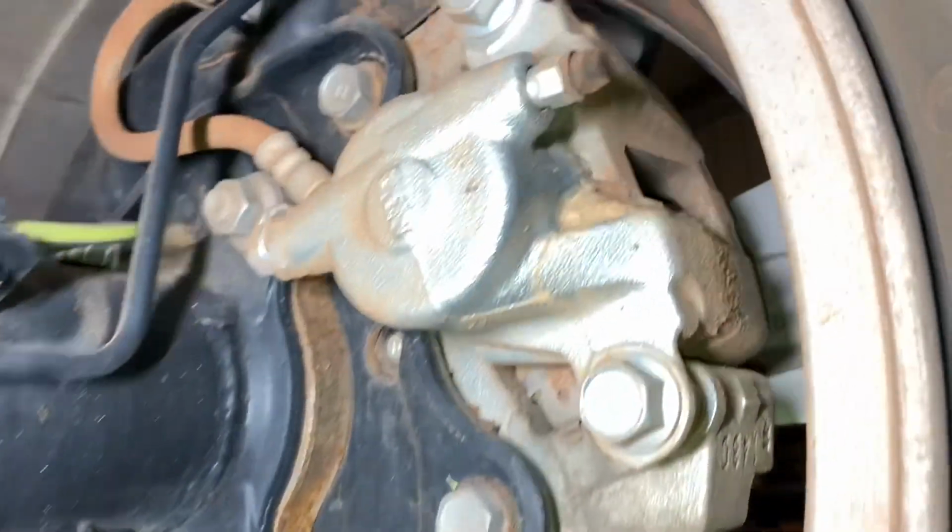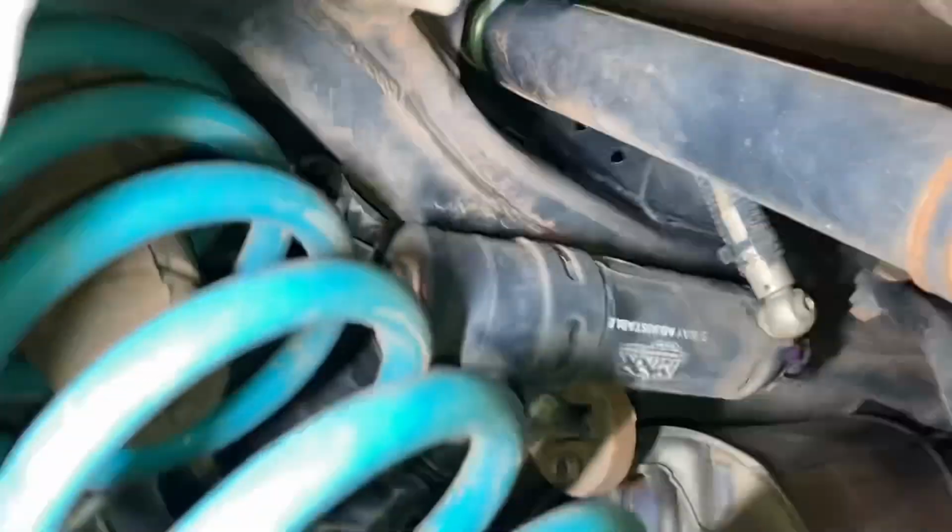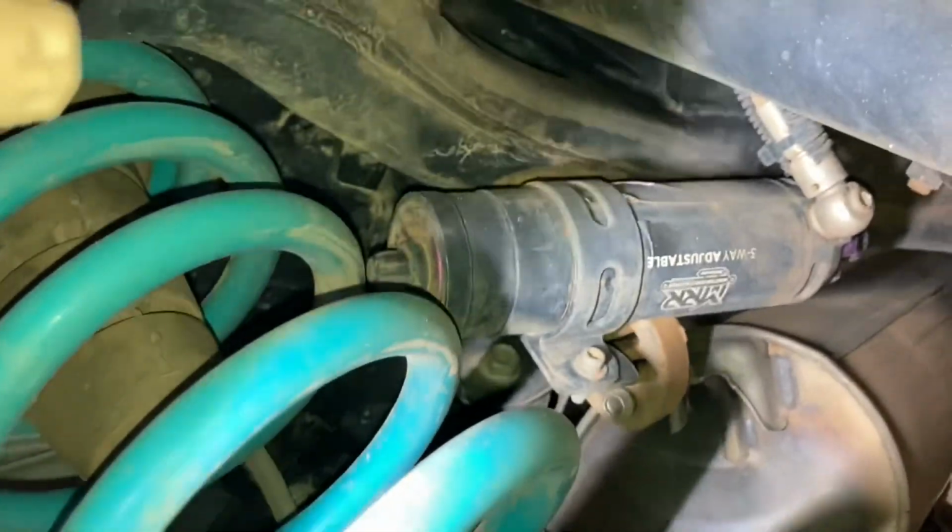And literally, we can go by the book, but it's our usual sort of inspection that we do on these vehicles, specialising in Prados, right? You can see there's no leaks. Looking for axle seals, looking at brake pads there, like new, still highway kilometres. I always go, is that remote reservoir going to hit on that coil spring up there? So we could probably have a closer look at that to see if it is, or if it has.